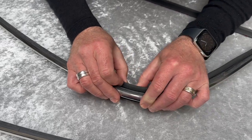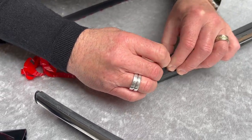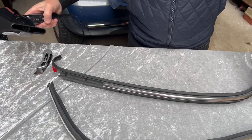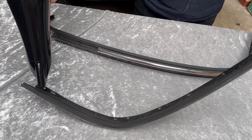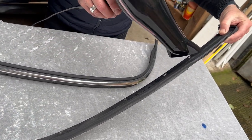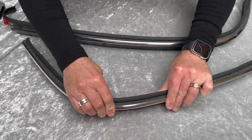At the other end, don't cut the rubber seal at this stage — just leave it overhanging. When you fit the trim back into the car you can trim that off for a snug fit. Another handy tip: once you've fitted the rubber seals to the plastic strip, use the hairdryer again to gently warm the rubber, then press it firmly into place. This gives extra adhesion and a nice sealed fit.